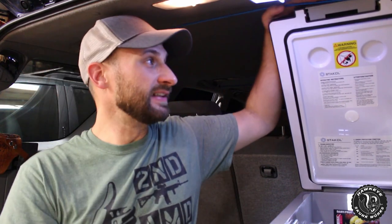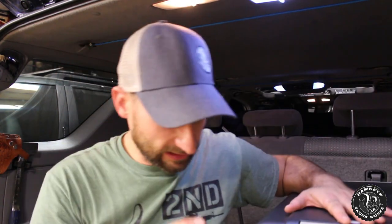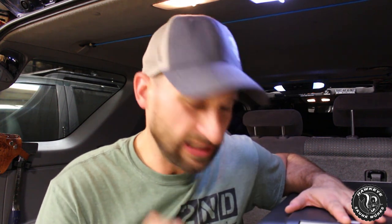There is a light in the back and it works very well. As for temperature fluctuations — set to 31 degrees, it will run down to about 27 degrees and turn off, then rise back up to 34 or 35 degrees before kicking back on. That's your temperature fluctuation: about four or five degrees colder and warmer cycling on and off, consistently.